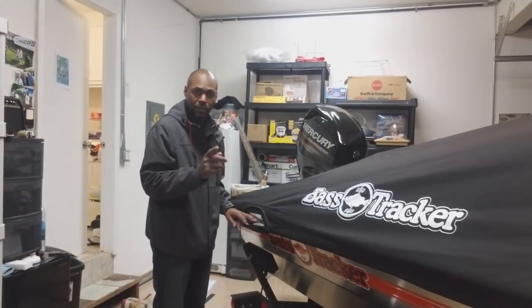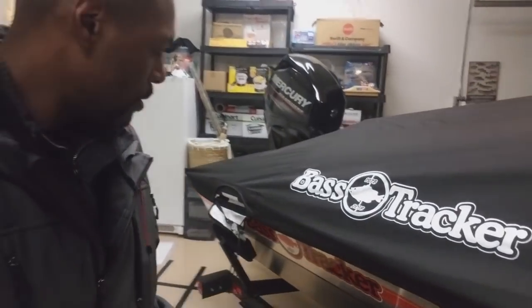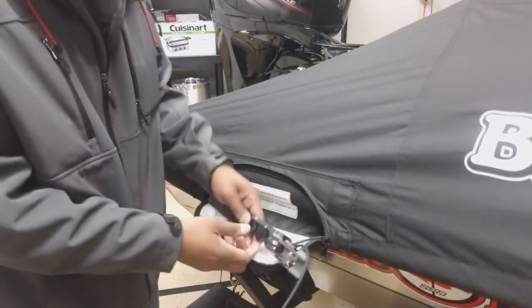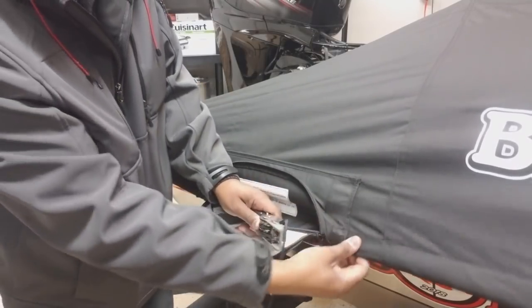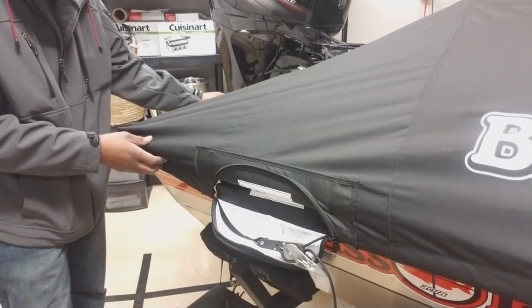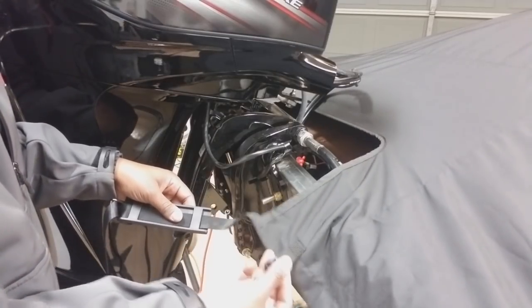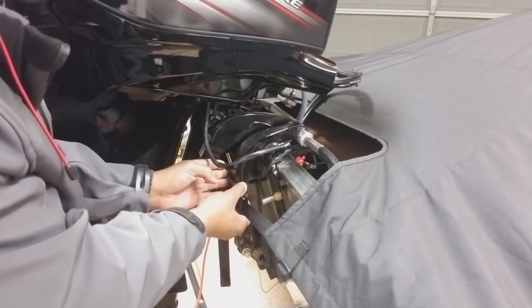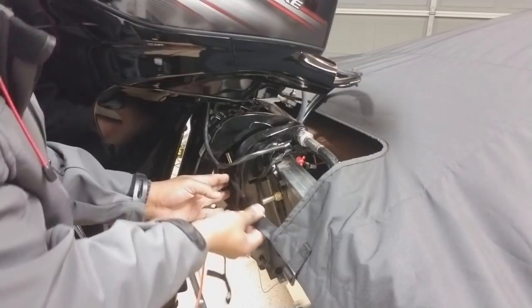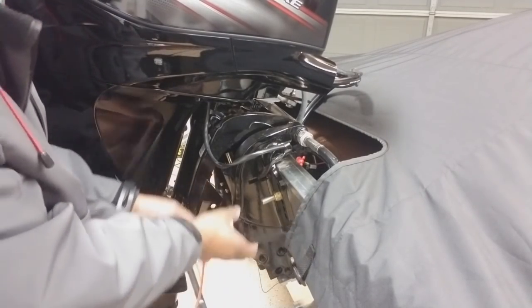If you are going to be storing your boat at home or trailering it, you must do this step. Now, if you can't get your cover on your boat, open this ratchet out and let some of this rope out. What you'll notice is one side has a strap and one side has a rope — the rope is what tightens down that cover, and the strap is what locks it down to the back of the boat. Here are the straps and here is another anchor point that you are going to anchor onto the bottom of the frame of the trailer. You're going to use this rubber piece — it comes across the back of the motor transom mount — and that is how you lock the boat up, one on each side.